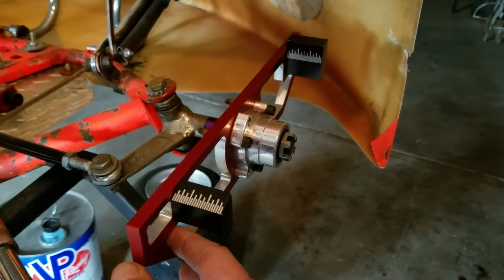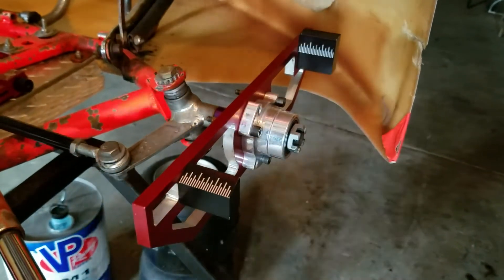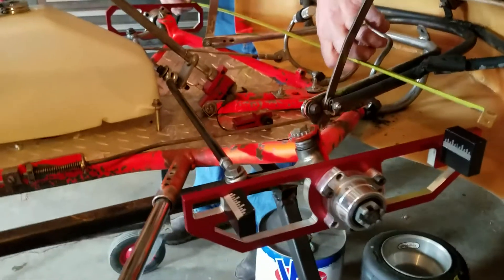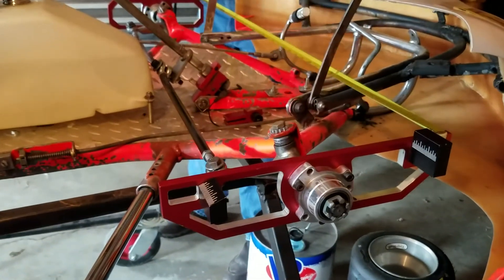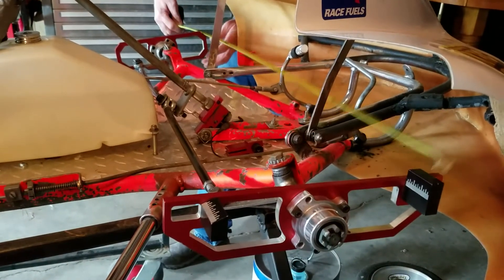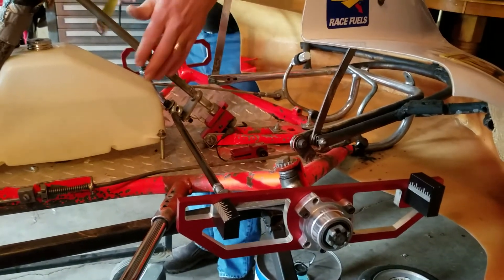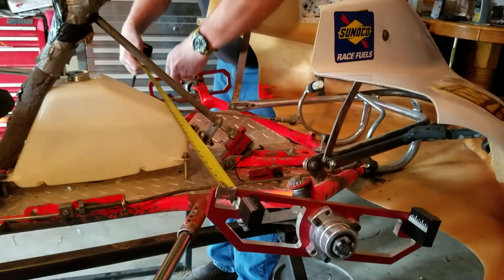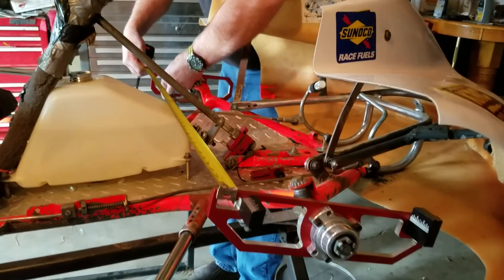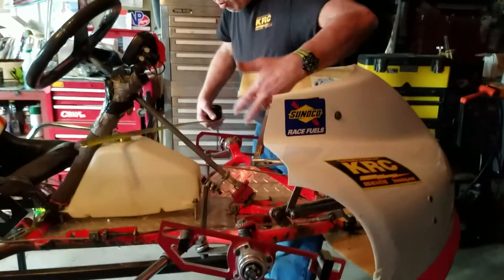It's kind of hard to see on camera. Now I'm going to get the tape measure and actually measure from this to this plate right here, and it's 37 and a quarter. And now I'll do it here — hopefully it's going to be the same. 37 and just a little bit, about a 64th less than a quarter. So now we have the whole chassis.